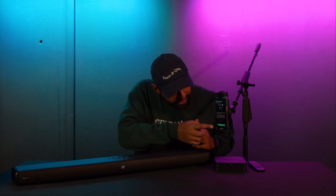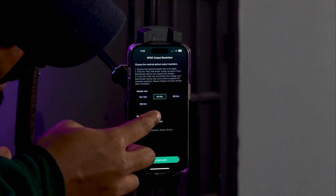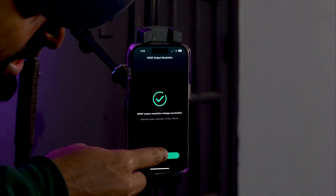The Wim Pro Plus is a high quality product — it has one of the best DACs you can get for home audio systems built into it, and it allows you to stream at 24 bit, which is a really high and well-defined bit rate. I'm going to set it to 48 kilohertz and 24 bits for the most optimal sound. It's actually playing music right now just to confirm that bit rate change was successful. Press OK and now we're on to the final setup step — giving permissions to work with all the other types of technology in your home. You can enable it for Chromecast, Alexa, or Apple Home on your iPhone, iPad, or tablet.